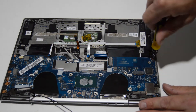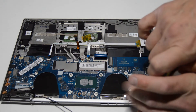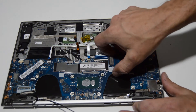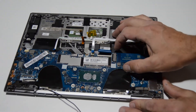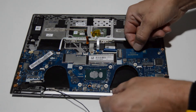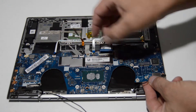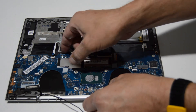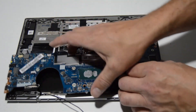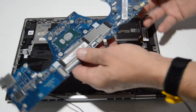Flip around to the other side — just a few more screws to take off and then we can remove the motherboard. When you go to remove it, pay attention to any ports that may be sticking through the palm rest so you don't break anything as you pry it off. Lift from the side that does not have any ports poking through, give it some gentle wiggling, and once it's free from the palm rest, slowly flip it over, making sure nothing is connected to the bottom side. That is how you remove the motherboard.